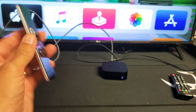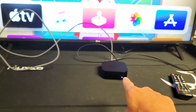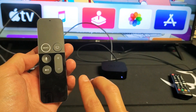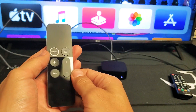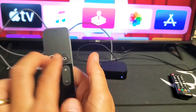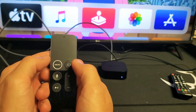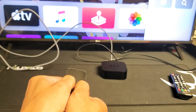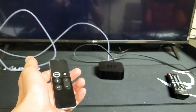If you're still having issues, here's the next step. Grab your remote — you can see my Apple TV is on by the solid white light. Press and hold two buttons: the Menu button and the Home button. Hold both together and wait until the white light starts flashing, then let go. We just forced the Apple TV to restart.